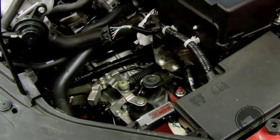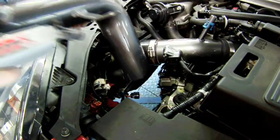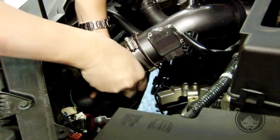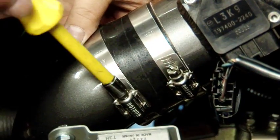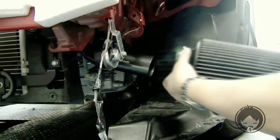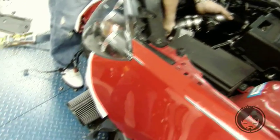With the stock air box out, we have plenty of room to work with. When you first put the hose clamps on, you want to make them all loose — just snug. That way you can move the pipe around and make sure everything's clear and straight. You can rotate the pipe to miss certain things, then go through and tighten everything down. You really don't need to take the bumper off for this install, but it makes life a bit easier. An intake is nothing without a good flowing filter like the dry flow. Don't forget to tighten the clamp, and don't blame us if you do.